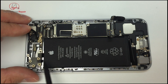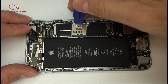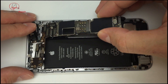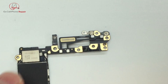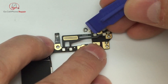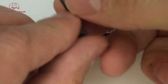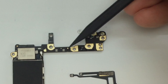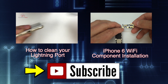Now you want to very carefully maneuver the board out of the housing. Make sure other cables are out of your way so you don't snag anything. Once we have the board out, we have access to the flex cables on the inside. These are the same types of antenna connectors we had down by the charging port — very carefully lift these away from the board and make sure you're not prying against the board itself. There are some fragile components on the right-hand side that I'm going to point out; make sure you're not applying any pressure to those tiny pieces. If you found the video helpful, like it, share it, check out my channel for more tutorials and product reviews, and remember to hit the subscribe button.